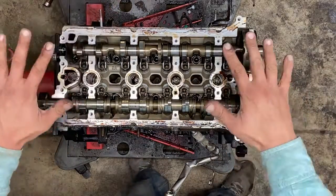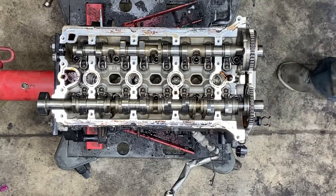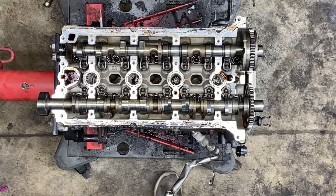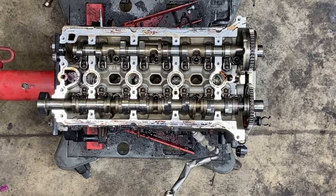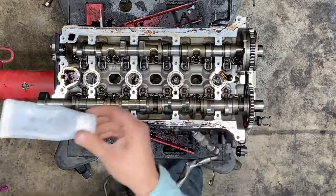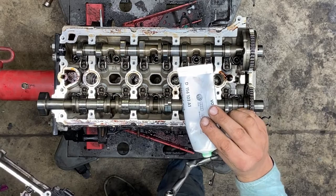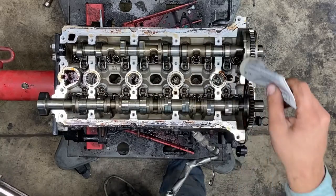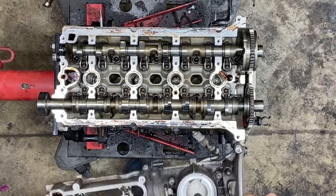This was just about setting the cams in here, and now we put the cam tray back on. This is just an example — I have a cam tray. I would dab it up again with grease, dab it all up. And I also would take my anaerobic sealer. You have to use anaerobic sealer. Audi has this lime green stuff — part number D154103A1. You go all the way around. Give me a bunch of comments if you want to see it done properly all the way through. I'm just giving a quick tutorial to help a brother out.